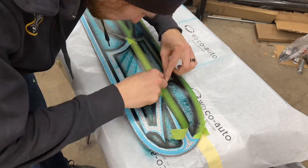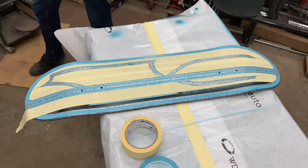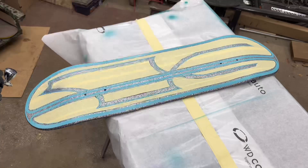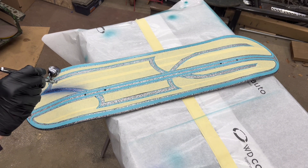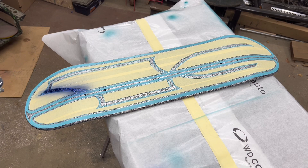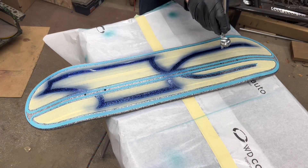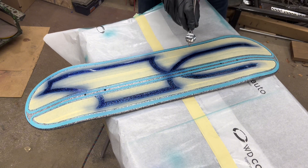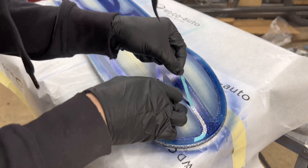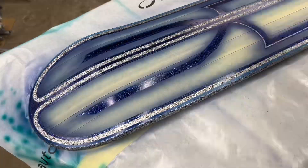And the first satisfying round of unmasking here — always satisfying to see that tape come off, nothing peeling off underneath, and everything looking really good. Now I'm masking over all the areas I sprayed that teal candy over, so I can start going over with the ultraviolet. One thing you didn't see in the time lapse there with my masking is that I'm linting all my tape, which means I'm peeling a long piece of tape and sticking it to myself — to my jeans, to my shirt, my hoodie. What that's going to do is take some of the tackiness off the tape, so when I stick it down, it's not going to peel up the previous layers as easily.